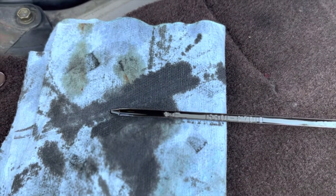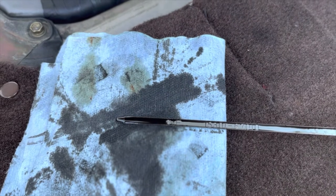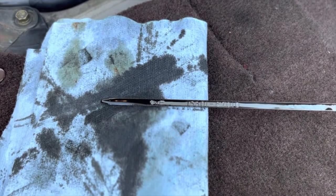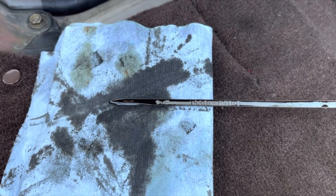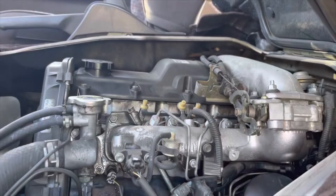Keep in mind your diesel oil will always be black - it'll never be honey colored. That's because of all the sulfur in the fuel. Some of the combustion seeps past the rings as blow-by, and that sulfur that gets burnt is like a black soot that mixes with the oil. That's why you see semi trucks and people who mod their diesel engines blowing a bunch of black smoke. Put the dipstick back in.